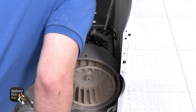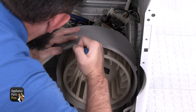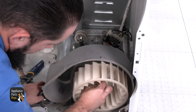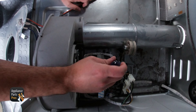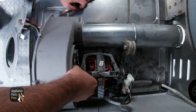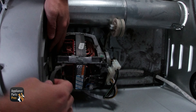If you find out that the motor on your dryer has failed like this one did, I'm going to show you how to replace it. To remove the motor you'll need to remove the blower wheel housing cover by taking out the 1/4-inch screws with a 1/4-inch nut driver. There are also two 5/16-inch screws holding the blower wheel cover to the cabinet. Now we're going to remove the blower wheel — grab an adjustable wrench and secure it to the motor pulley.